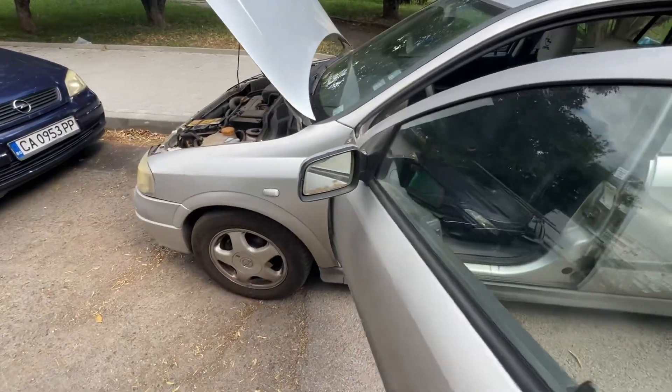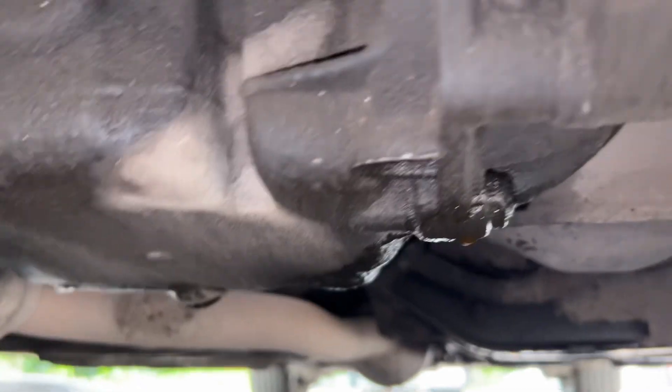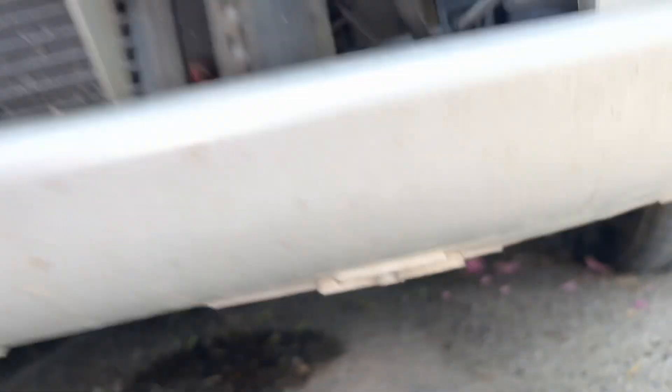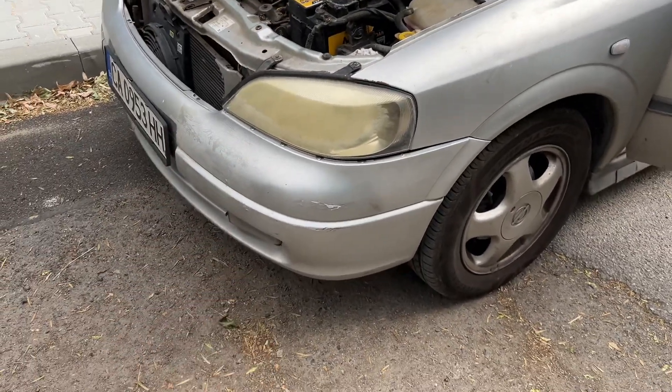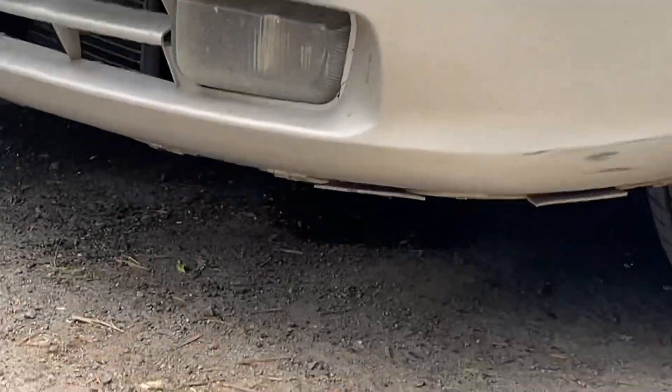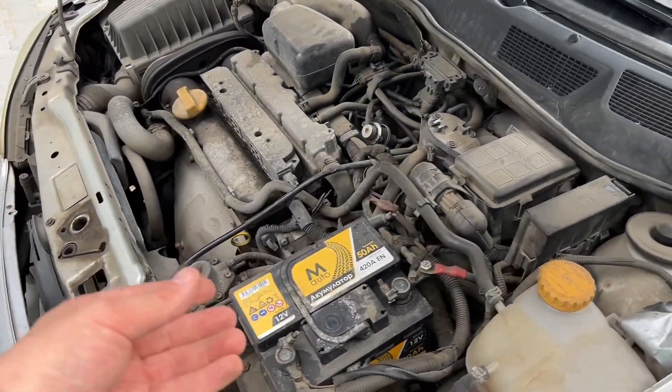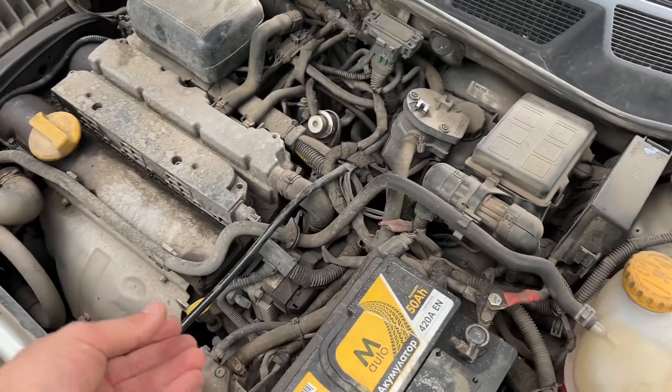Let's have a look at the bottom of the car to see if we can see any leaks somewhere. You saw underneath the car — that's where this thing is. It's leaking in the middle, in between the gearbox and the engine. I think the problem is the slave cylinder.